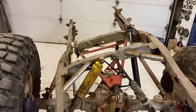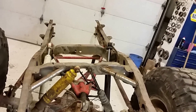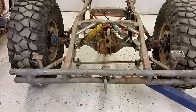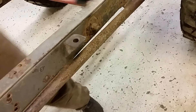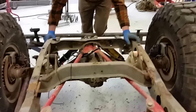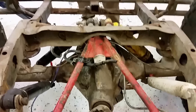What I'm saying is, everybody who builds a suspension needs to run it. There's compromise. You may have to limit some articulation so things don't break themselves apart. It does make a really nice compact package. I'm still missing about an inch there — the clearance. Come up front and I'll show you what I'm binding on. It's kissing the cross member here and here, both sides right there. How the hell did we never hear that or see that? Well, when it comes down to the end of it, it just kisses a little bit right here — you can get it all the way if you work hard enough at it, but that's not suspension travel. You'll see rust marks and wear marks on those points — very heavily. Time to learn.